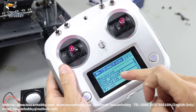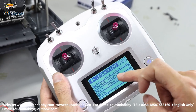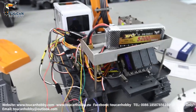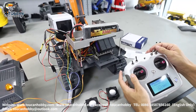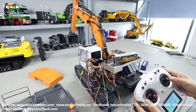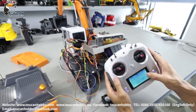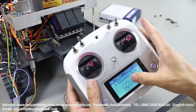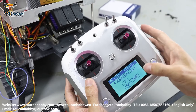Go out to function and come into assign auxiliary channels. We will see one by one. Power on. Channel one is rotation. Channel two, switch on the pump — it already controls channel two, that's the front arm. Channel three is the big arm. Channel four is the bucket. Channel five is SWA — that's the pump. Set up channel five, click, choose SWA, then click SWA to control the pump.